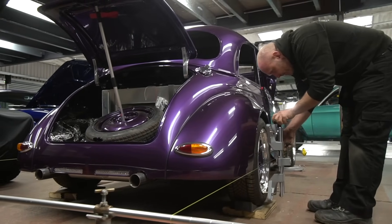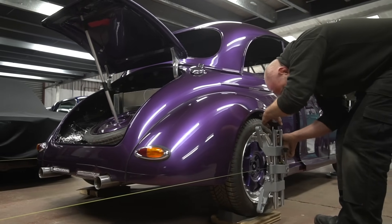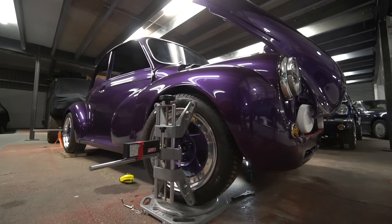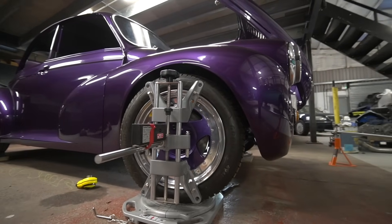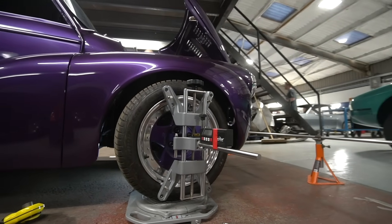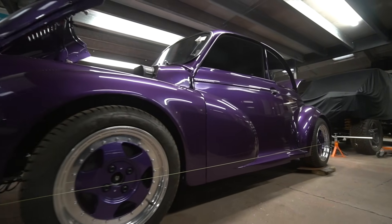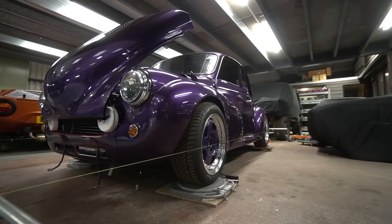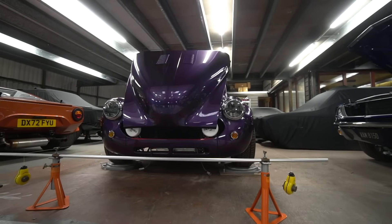Morris is on the turntables and Bobby's been setting up the alignment on that. Frustratingly, I'm still waiting for one metal 3D printed part for the doors - it's the part that the exterior door handle operates in. One of them was okay but there was a fault with the other, so we're waiting for the replacement from the manufacturer before we can finish the door builds. There's a domino effect: you've got to get that in first, get the door handles in, then all the glass, regulators, and frames, and we can button that lot up.